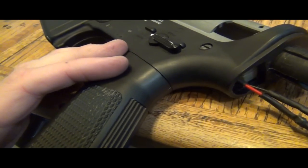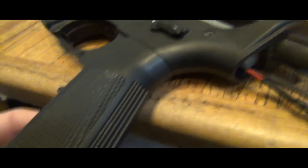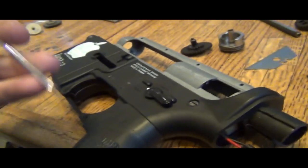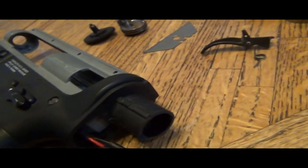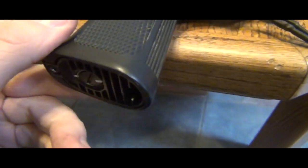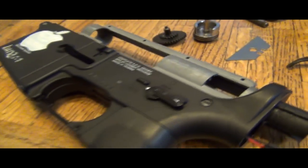Okay, I put the bushing back in and thread locked it, and then I checked again to make sure that there were no changes in the bevel and pinion, which there haven't been. I did shim this and this, so they're ready to drop in, but I'm probably going to wait about 24 hours, let that thread lock get more permanent, and then we'll know what the real test will be with the spring in. So we do have it at the same motor height, and I checked again with the screwdriver, so it means it should be perfect when we go to test it.